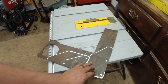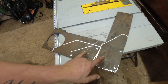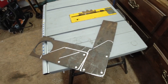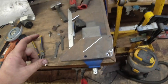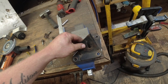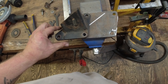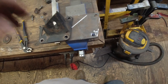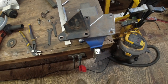I drew out my templates for my engine mount adapters to bring it back so we can get it to clear the suspension. I'm going to get these holes drilled and then get these cut out and see how things look. So here we have the passenger side bracket — where the engine mount used to sit here, it'll now sit here. We're going to weld it on and it'll be held by one of the bolts too, so it should be nice and strong. This is nice thick quarter inch plate.